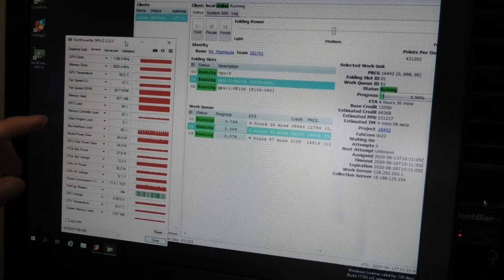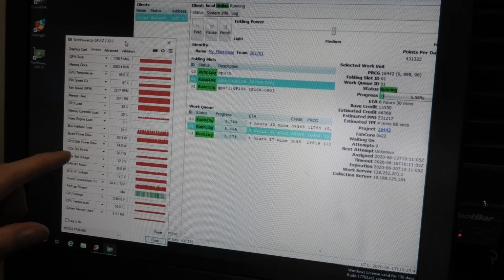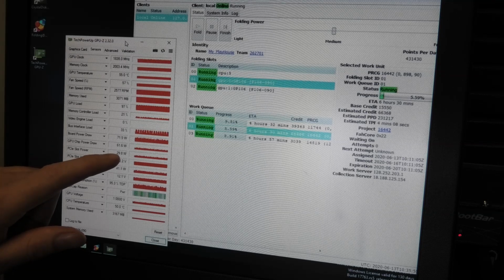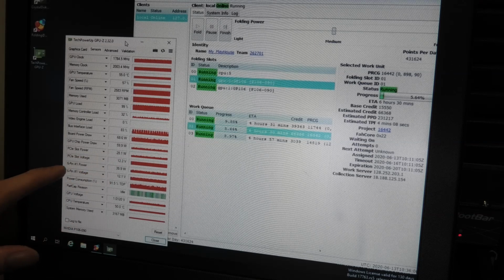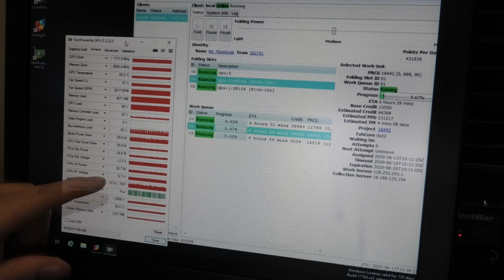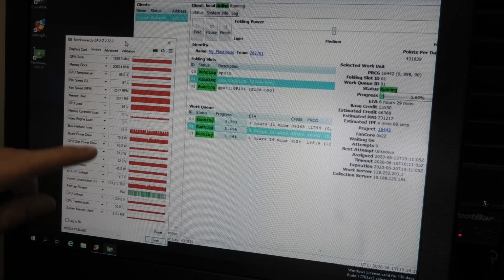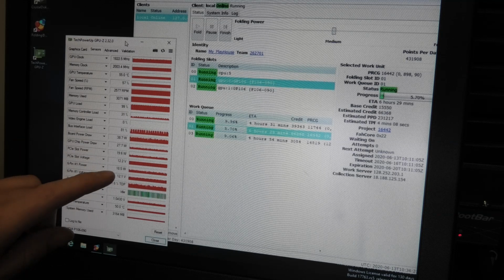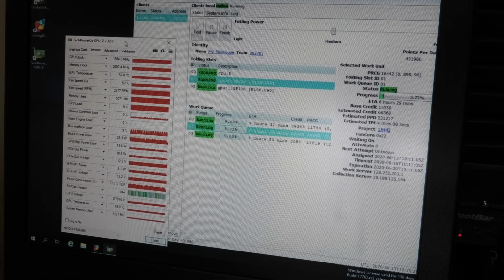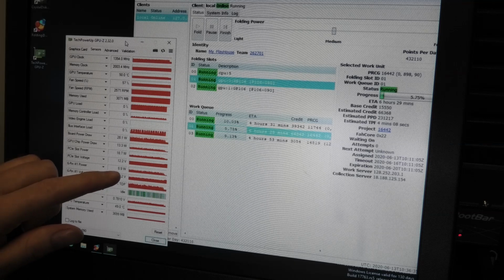And it actually tells us where that comes from. It says here that this amount of power, 30 watts, is coming out of the PCI Express slot, and here is what comes from the 6-pin connector. It varies a lot all the time, but 40 watts sometimes, and so you can actually see where it drains the power from. A 6-pin connector like this should only be able to supply about 75 watts. Shouldn't go much over that. Oh, right now it dropped down to nothing. Something...